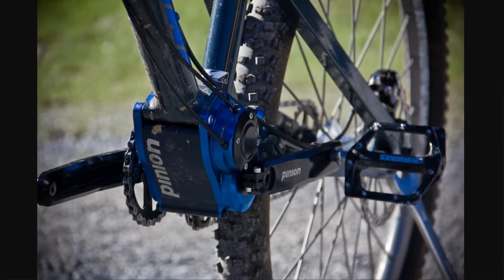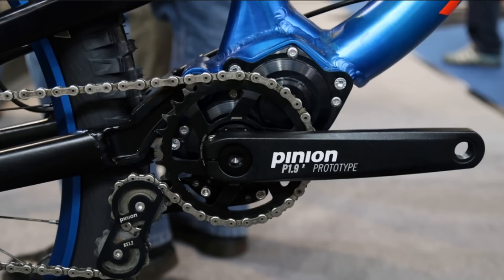And why all of you would really like this bike is because there's almost no maintenance. Every two to three years you have to change the oil on the system. Basically the Pinion system is guaranteed for the life of your bicycle — about six to seven years — with no problems wearing out or replacing parts. Also the chains last seasons; you can probably get one to two years out of the chain. Because the chain has no shifting along a cassette, you're not wearing out any bushings and the chain really doesn't stretch that badly.